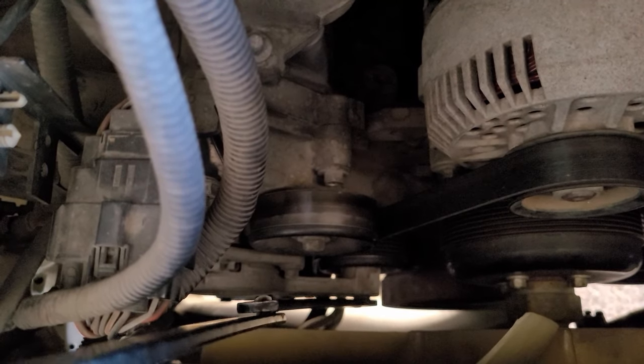We're going down the highway at about 65 miles an hour — the air is blowing at about 44 degrees, and it's 104 degrees outside, so it's a 60-degree differential. The system is working pretty good. Sitting at idle with 104 degrees outside, we're getting about 60 degrees out of the vent with the fan speed on number three out of four. Keep in mind this is a V10 and it only idles at just over 500 RPMs, so you're not going to get the coldest air at 500 RPMs. When we're going down the highway, we're getting 42 degrees. I call it a success. If you found this video to be cool, like and subscribe.